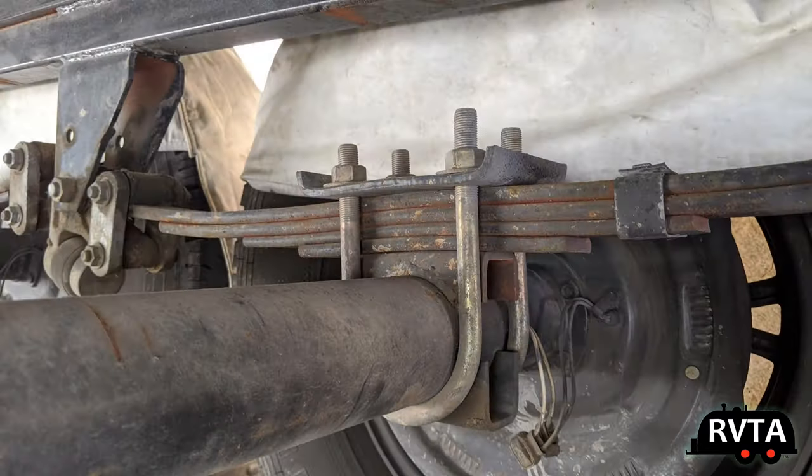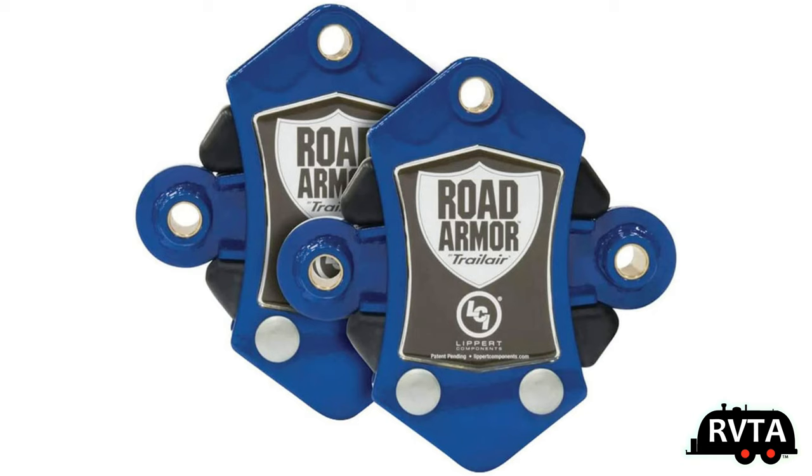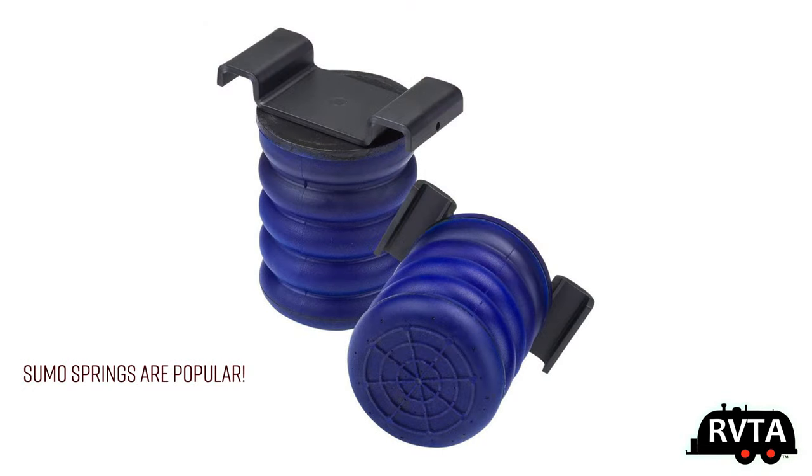The second thing I want you to look at when you're buying an RV is the suspension. There are different qualities and features offered by suspension. The first type is leaf spring. That's been around since stagecoach days. If you've seen movies with stagecoaches, they actually use leaf springs. About 80% of the RV market, I estimate, uses leaf springs. They're pretty simple and easy to maintain. Some of the upgrades are where the two leaf springs, if there are two axles, come together, and there's a different type of device from different manufacturers that upgrades and isolates the two axles to a certain extent. Very durable, very high quality, very simple design.